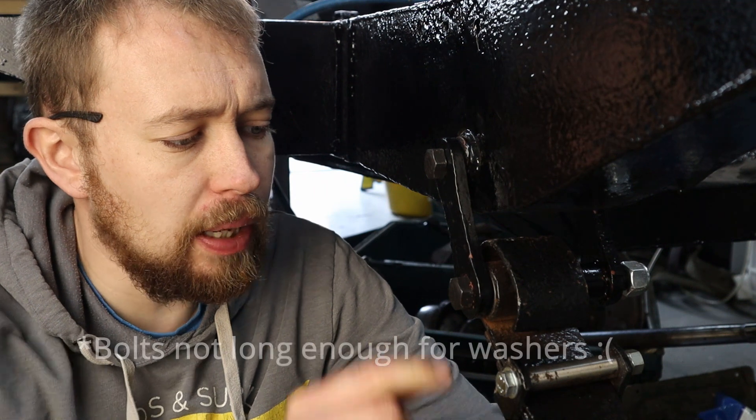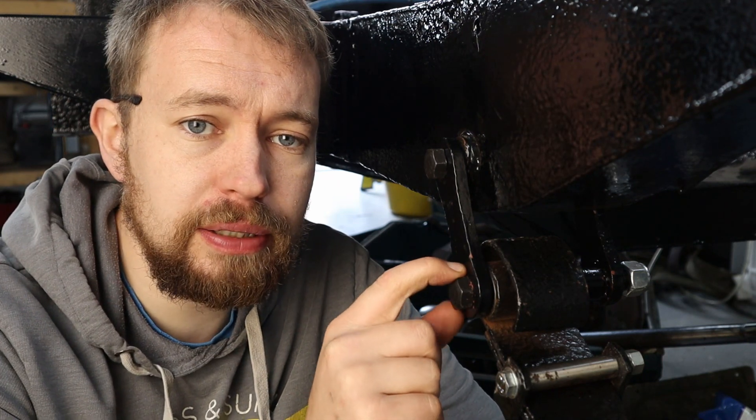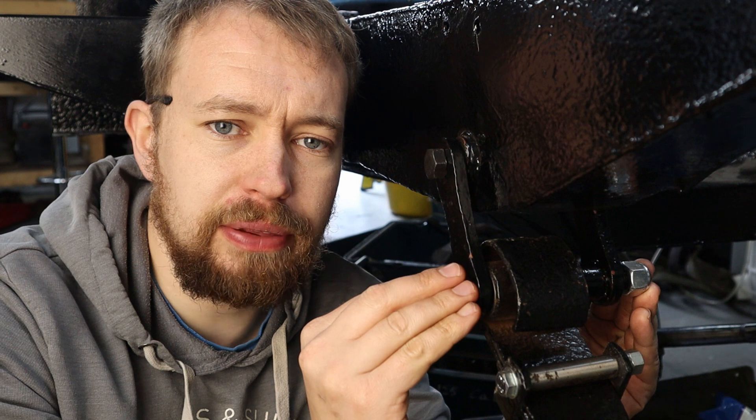That's the suspension pins back in, and I am going to come back and put some washers in here because I'm not really happy with a hexagon sitting up against a painted surface — I didn't really think about that before I started. It's important to not tighten these up before the weight of the vehicle is on the suspension, because you don't want to pinch that bush in the unloaded position and then put it under permanent torsion when the weight of the vehicle is on its wheels. So I'm going to leave all of this fairly loose, but it will enable me to put the axle on front and rear.